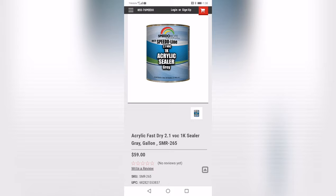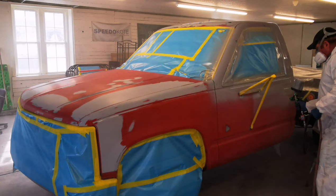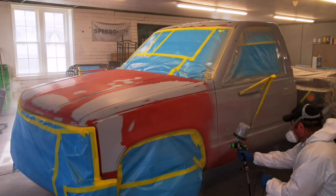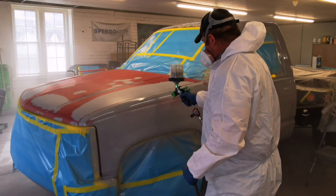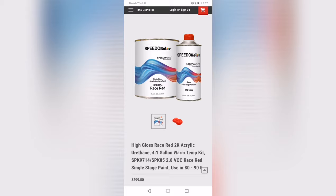One of my staple products for these full body paint jobs lately is I have actually been sealing every single car and truck that I do. This provides a super slick, super smooth, and also absorbent foundation for your base coat and/or single stage paint to absorb into. The 1K sealer sprays incredibly smooth and provides a superior bonding layer between the old paint and the new paint, and is very crucial for adhesion and how smooth your paint job will come out. The product is incredibly user friendly — it's one nice wet full coverage coat and you're done, moving on to your base coat or single stage paint.